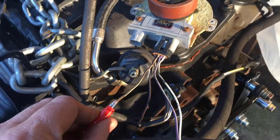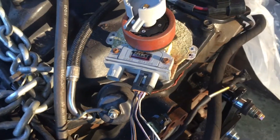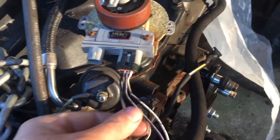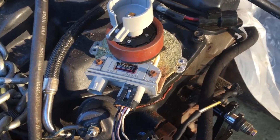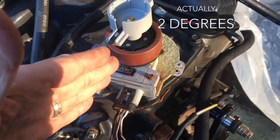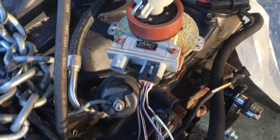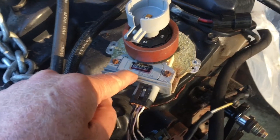However, if you remove 12 volts from the bypass wire, the module now runs off a built-in timing curve. These modules were last used in probably about 1995 in Chevy trucks. At the end of this video, I'll show a chart with the timing curves for the 3.0, 4.3, 5.0, and 5.7 that are built into the modules. The 5.0 and 5.7 use the same module because their curves are only one degree off, so you just adjust the distributor by one degree accordingly. The 4.3 is significantly different from the 5.0 or 5.7, so it requires a different module.